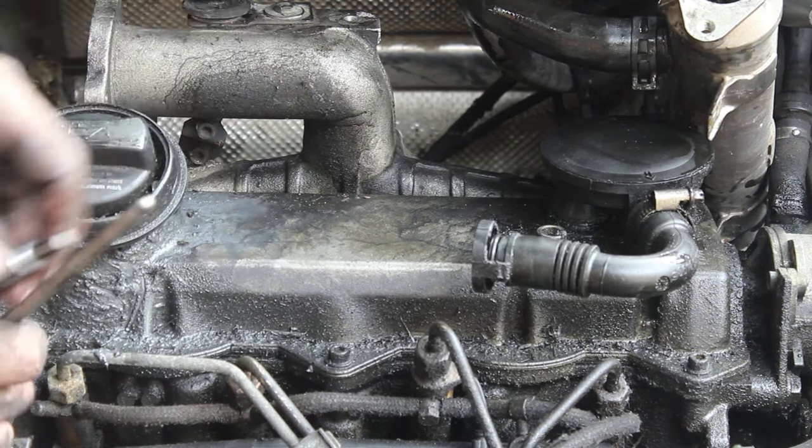All right, the intake manifold is now cleaned and ready to go. So installation is just the reverse of removing it. Make sure that you use all new gaskets on everything. Check the torque specs, which I hope to have in the bottom of the show notes here.